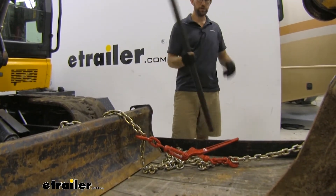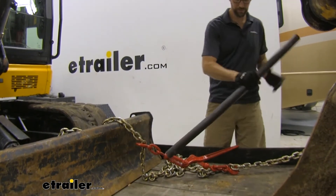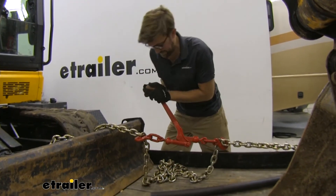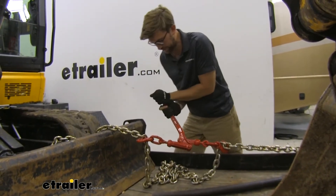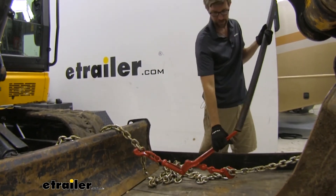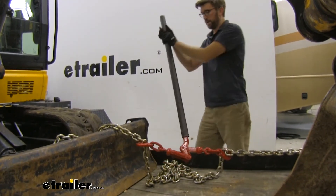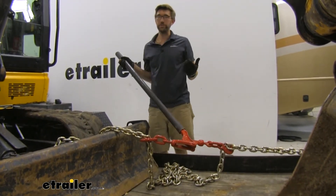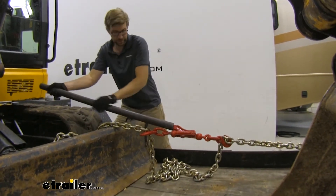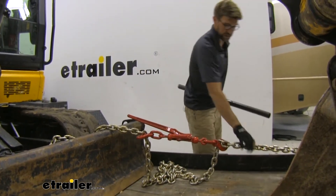So that's when grabbing a pipe comes in. This is the only one we have — you might be able to get away with something shorter. What I'm going to do is put that pipe on there to give us a little bit more leverage, at that link where I can't quite get it there. This is just one more thing you have to keep with you, and that's why I'm not a big fan of this style. Some people prefer them, but you can see it's a little bit easier to get in place. We have a really tight chain now.